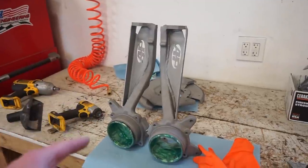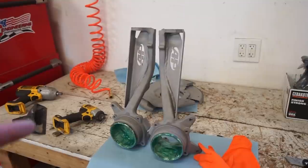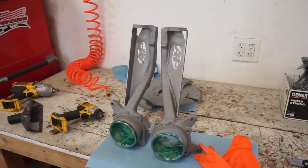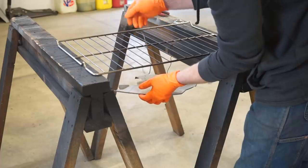Once the part reaches 400 degrees, so not 12 minutes overall, we'll throw it in, we'll use an infrared thermometer. Once the actual part hits 400 degrees, then we'll bake for 12 minutes. We'll pull it out and we're done.